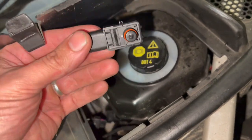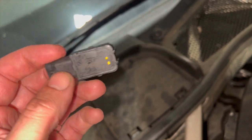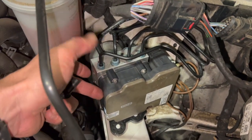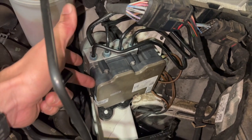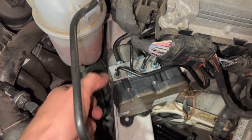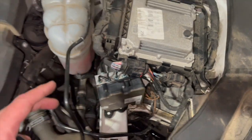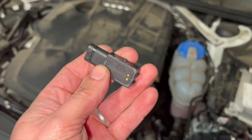That's released a bit of pressure as we took it off. There are the two little tabs holding it on either side - quite easy to get out. I'm going to do a couple of checks on the old sensor with the multimeter before fitting the new one. Just there under the bonnet is the ABS pump - it's quite a common issue causing the same codes and the communication faults. We've had that sent to ECU Testing. Straightforward to replace: undo the six pipes, undo the main connector and send it away. The worst part of replacing the ABS pump is just bleeding it up after - takes a bit of time. That's all refitted and brakes are bled back up. We're just left with this sensor fault now.